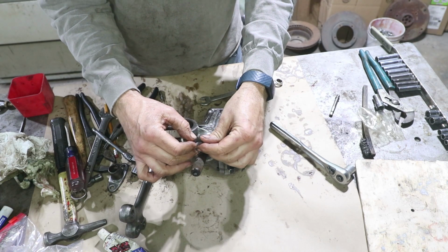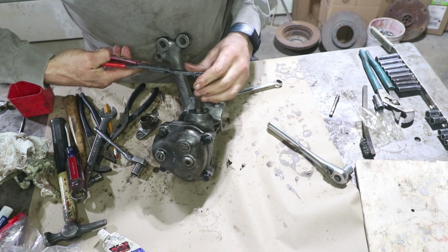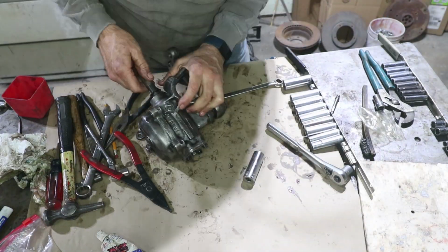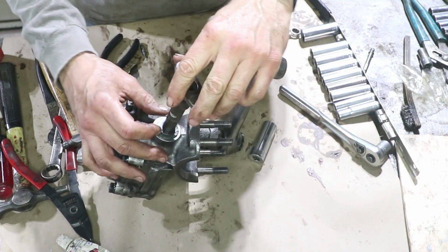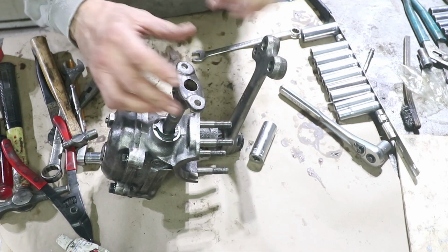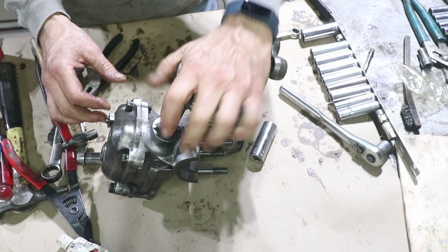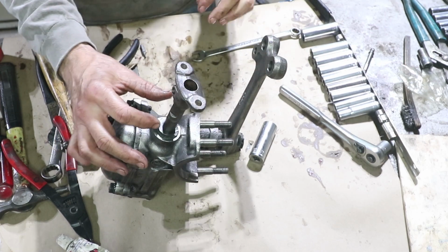Pointer goes right here. All right, that pointer's adjusted and pointing to the right place. That does correspond with the tight spot. So I think that's just helpful if you're working under the car, you're doing alignment. You have to make sure when you're setting the toe in that this is pointing right at that mark.